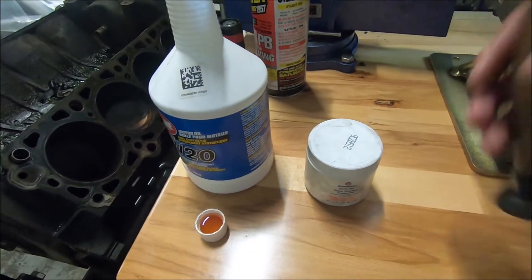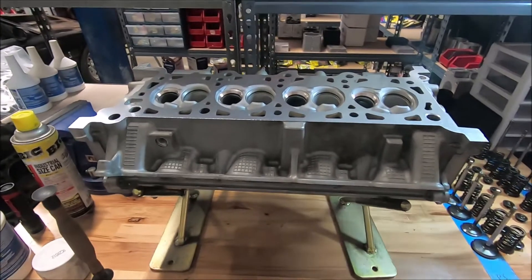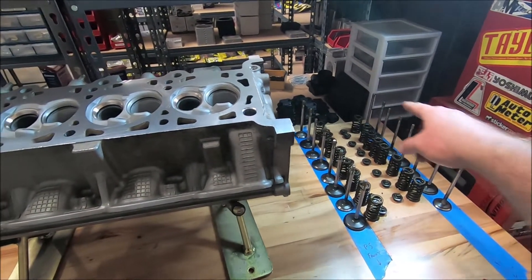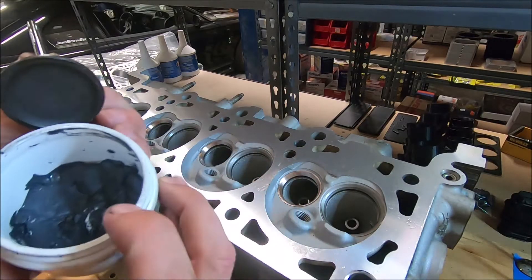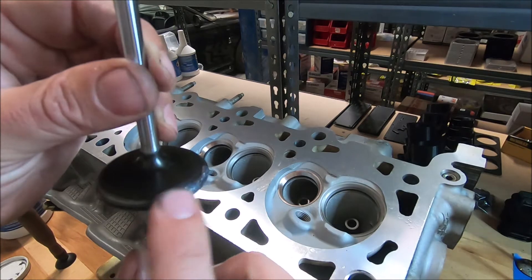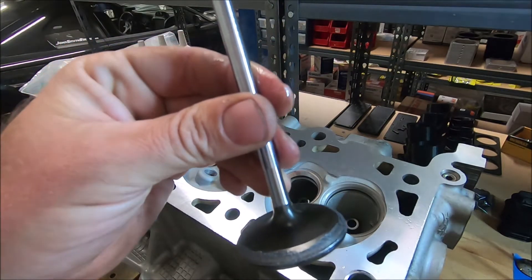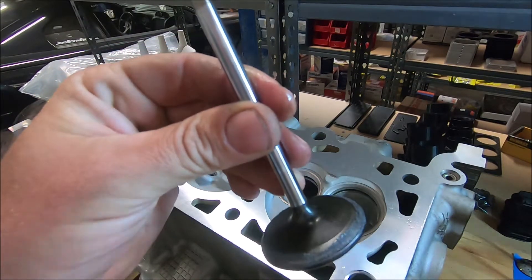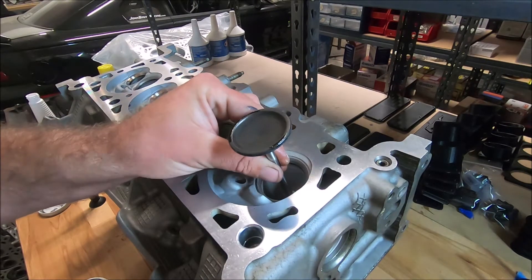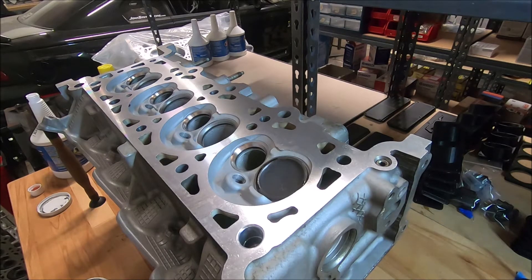Next I'm going to lap the valves in. To do that you're going to need a valve grinding compound, a valve lapping tool, and some oil. So this is the driver's side head - this is the back - so I'm going to start with the back valve and work our way in. I'm going to take some of the valve lapping compound and coat it right around where the valve seals. You can see there's just a little bit on there - it doesn't take very much. This stuff is like liquid sandpaper, so you definitely don't want to get it down into the guide or anywhere else. Make sure you have lots of rags to wipe everything down. Now we can put our valve in there - I like to put my hand on the bottom too to make sure it doesn't slam down and shoot that grinding compound all over the place.